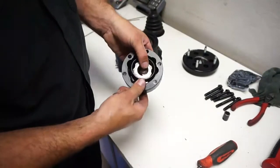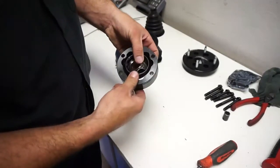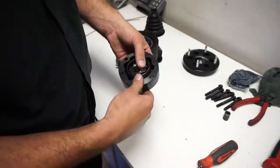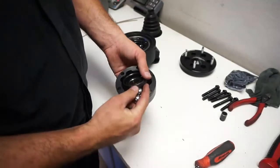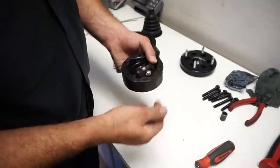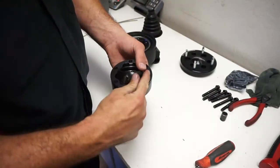You can't line up big, big. If you did that, it wouldn't plunge at all, it would just be real tight. So basically you want to line up the small with the big. And the cage doesn't matter where it goes. With my hand underneath it, I'll just kind of pick it up like that, line them up and then just stick a ball in there. That'll start indexing it. I'll turn it a little bit and kind of pick it up.